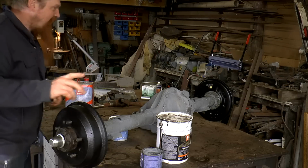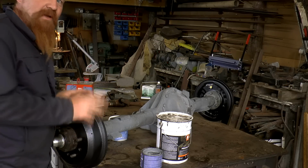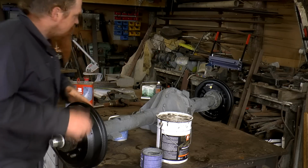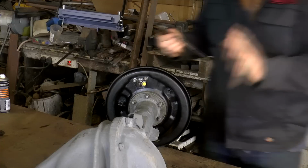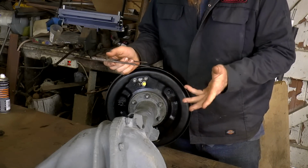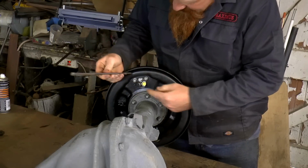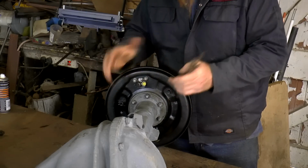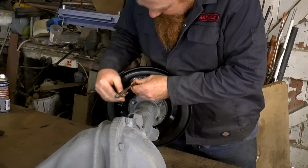One thing I do want to point out, actually, I have just discovered this. I reread the article on Expedition Land Rover about 109 brakes. I found out that the back plates, so these bits, are handed. I thought they were the same. And this is not in the manual, not even in the official Land Rover manual, but it was in a technical bulletin that they issued after the fact. Thankfully, we did fit them right, but only by luck. Yes, 50% chance, and we got there.